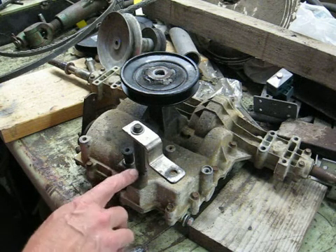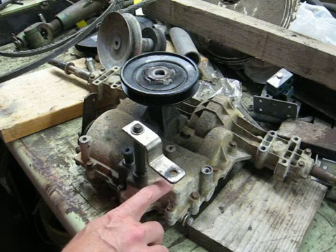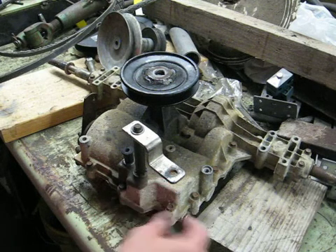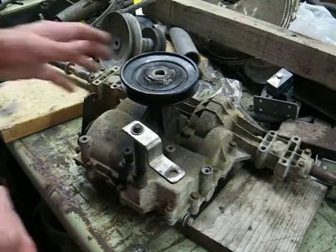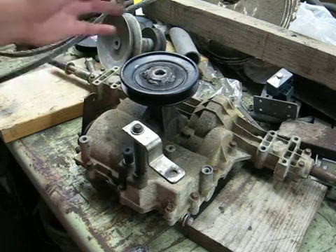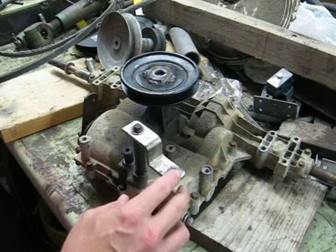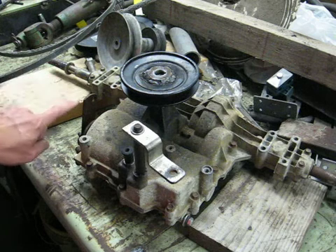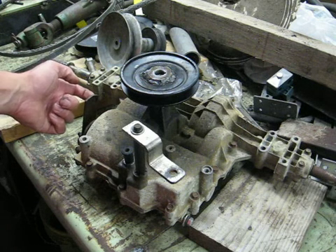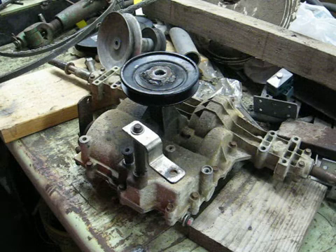The MST here from the Murray should go in. This is a little different setup where the Craftsman has a lower lever down here. The linkage should work close enough considering that I've also raised the body up one inch — I referenced that in my previous video, video number two, on the all-terrain mo-cart build. We'll have to change this brake lever because the Craftsman has a tab over here and pushes, where the Murray has a rod that hooks through this hole and pulls this way.